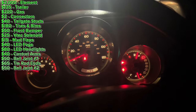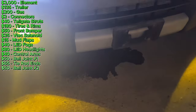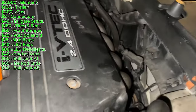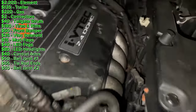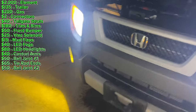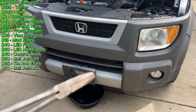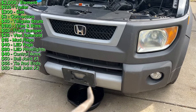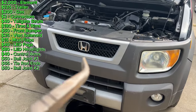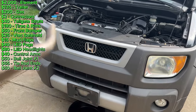This is not good. I was just cleaning up the garage and I noticed there's water on the floor and it's overheating. I could have sworn both the fans were working. The overflow was spilling out and the fans are not spinning. I turned the air on and now the fans are spinning. So the fans only turned on when I had the air conditioning on — it should turn on once it gets to a certain temperature if the air is not on. I've got to figure that out, but I'm going to start with the coolant.